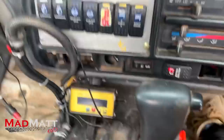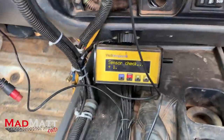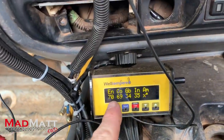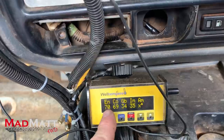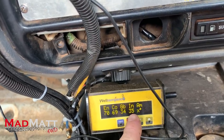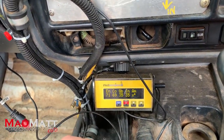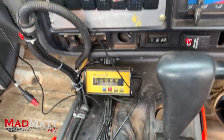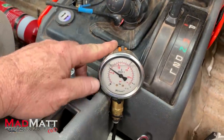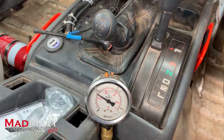This device here is called a Well-Tempered unit — it's no longer available but it's an excellent device for monitoring temperatures. For redundancy, both of these are monitoring the same point on the engine, and this is monitoring gearbox-in and gearbox-out temperatures. You heard the beep — that alarms if it goes outside the parameters I've set. It's a nice safety thing because when you're racing you don't have time to be looking at gauges. I've also got this gauge for measuring the air pressure in the air tank, which is handy so you can see what's going on.